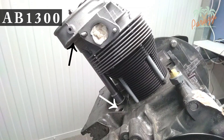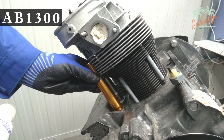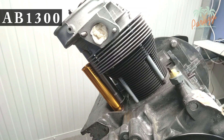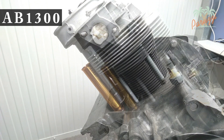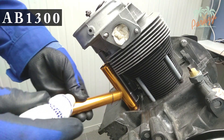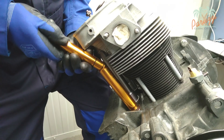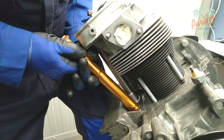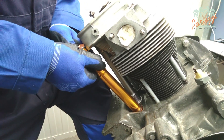Check again that the mating surfaces into which the rubber seals fit are clean. Use glycerin to minimize the resistance of the rubbers. Lubricating the O-rings with glycerin or engine oil helps the two tubes slide over each other. The spring gives a fair amount of resistance but can be pushed in by hand. You may replace one tube with a spring-adjustable one and leave the other tubes in place.